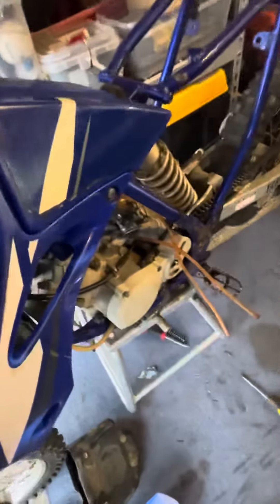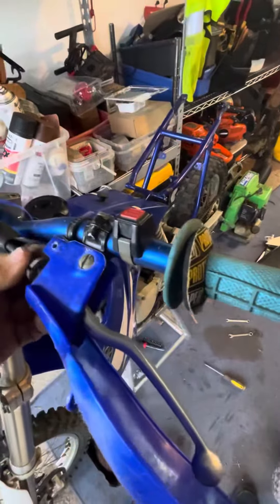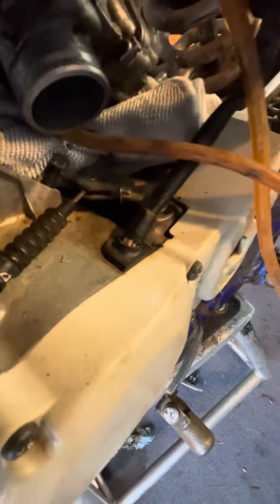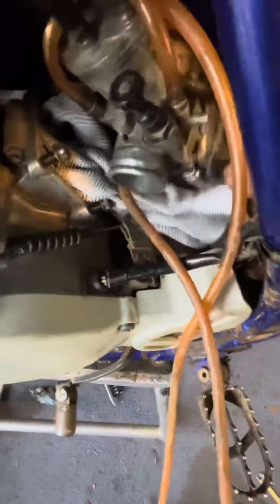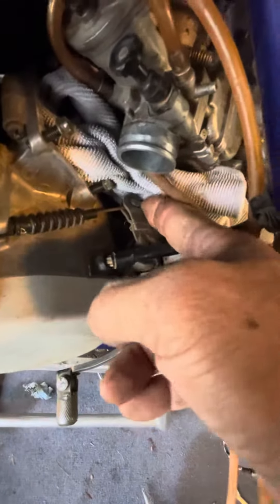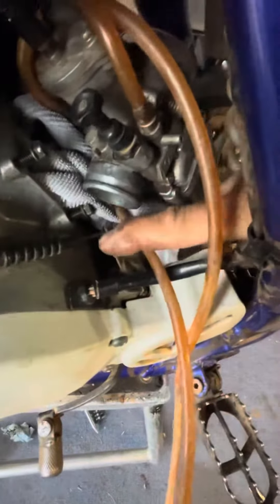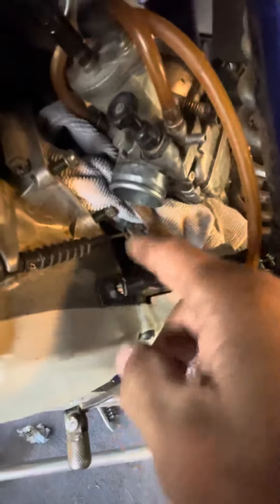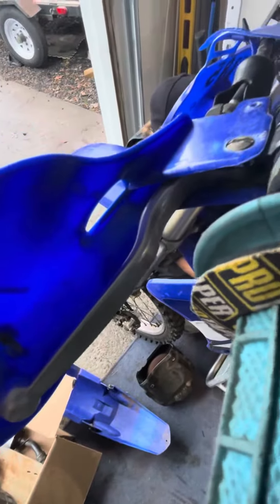So what you want to do is go somewhere in between here, and I'll show you exactly how to do that. Turn this knob out and adjust this. As it starts taking up the play, make an adjustment. You'll see down here at the same time — wiggle this back and forth and you'll see this moving. When it gets to the point where you have just a little bit of play on this mechanism right here, you can move this by hand. That little bit of free play is what you want at all times. You want this to be relaxed so the clutch isn't pulling in and you want to have that free play. That little bit is up here on the lever — you'll see when I'm moving this, it's actually moving the lever.